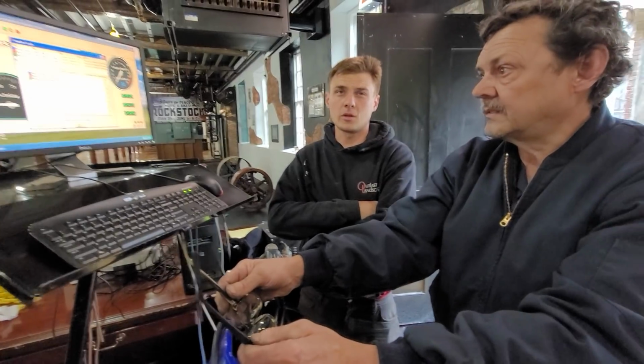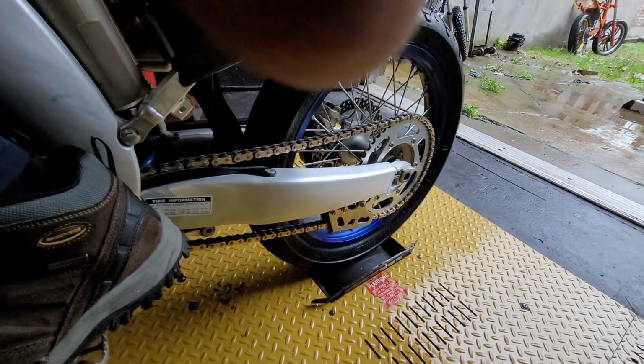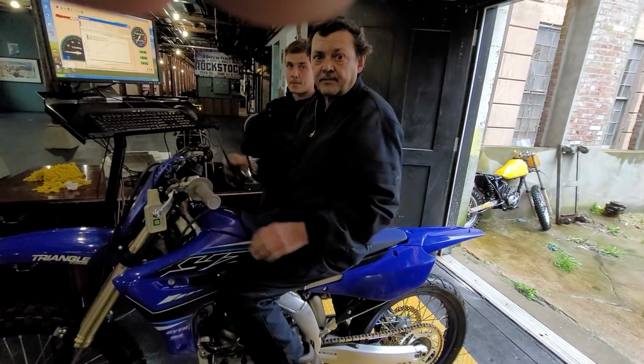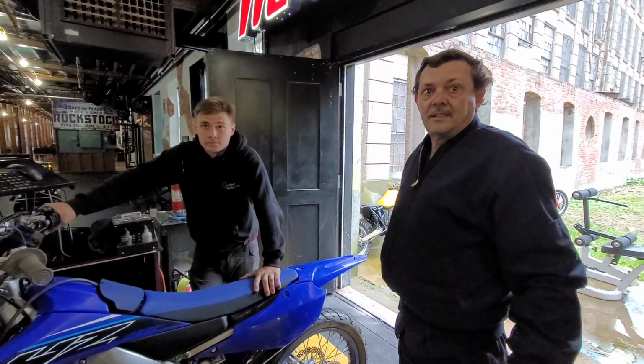Yeah. I mean, the factory says 58.67 in the manual or whatever it is. That's at the crank, man. Yeah. That's right here. At the crankshaft. That's what they mean. They don't mean back there where the rear tire is on the ground. Dynojet states it's 12% difference. Okay, so take 12% of 53. Boom, there you go. Yeah. That's 58 horsepower. That's right on the money.